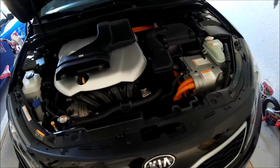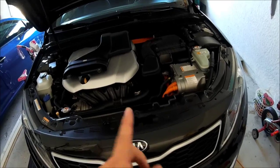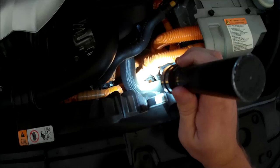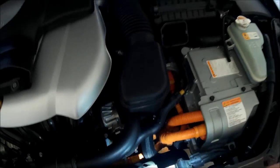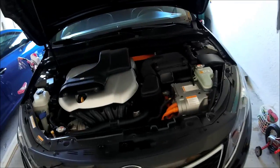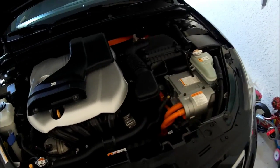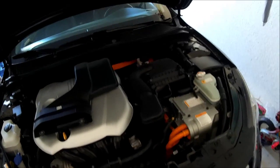I figured I would try the same method I used on her car. Her car had to take the intake off just like this, but I knew the intake on this car went to the back of the motor. So I thought I'd try it this way. I took the snorkel off, and right where I'm shining the flashlight straight down, there is the overflow — you use that with the 3/8ths or quarter-inch with the 3/8ths adapter. So I decided to fill the transmission through there rather than that little bolt in the back, and obviously being an overflow, any excess will come right out.